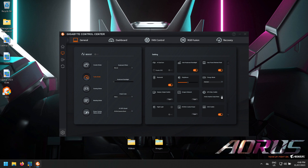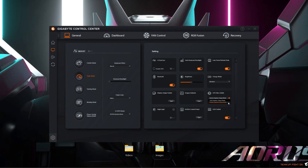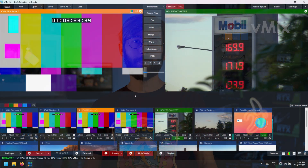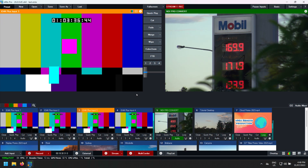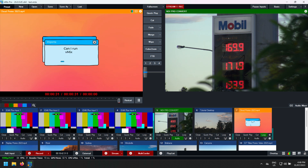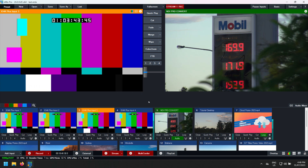Let's fire up the laptop. First, I'm going to access the MUX switch — although I wish it was a giant physical switch, it's just accessed via software. For this laptop I need to go into the Gigabyte Control Center software, find the MUX switch, and set it to my dedicated GPU. Each manufacturer has a different program for this, so just check the specs of the laptop. Here's a production I set up for testing: it's a 1080 29.97p production with four cameras via Thunderbolt.